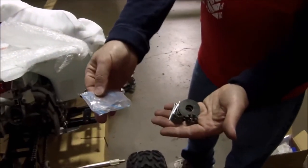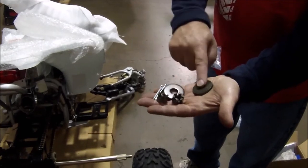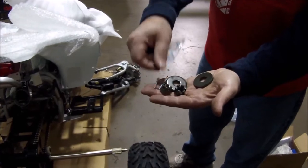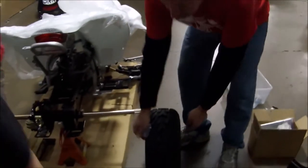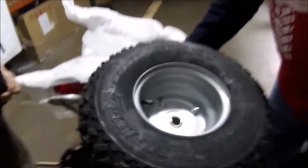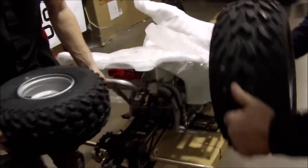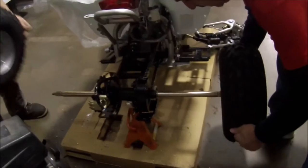I just opened the rear tire package — the bolt package. What we have is the big washers and they hold the rubber covers on. The two nuts that have cotter pins — all this comes in the same package. Now if you want to look at the tires here, they're directional. This direction goes forward and it says direction of rotation right here. This is the right-hand side one, and that one Keith is holding is the left-hand side. So we're going to put them on.